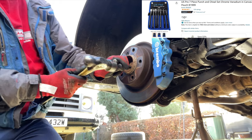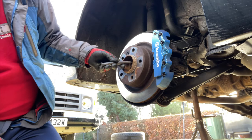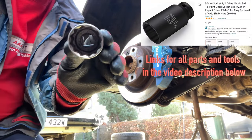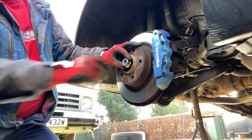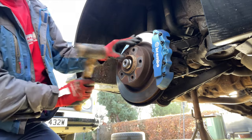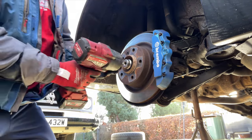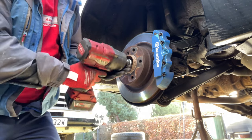We've just got to tap off this locking nut — it's got a couple of tabs either side, so we'll give them a bash just to chip them out. Just a 30mm 12-sided socket. You need a socket that's got some really good purchase on these nuts because they're so blooming tight. I'm going to have to whack this one on because it's got a bit of rust on there — we'll get that copper hide hammer again. This side isn't as corroded as the other side, so this is going to be the easy one to get off. The other side I'm dreading. These nuts are 420 Newton metres when you do them up.